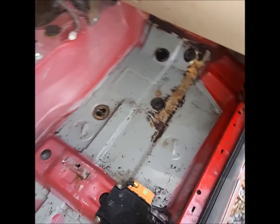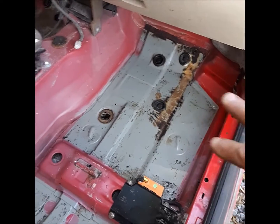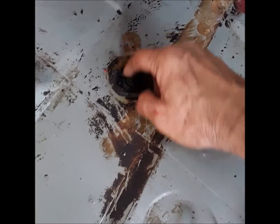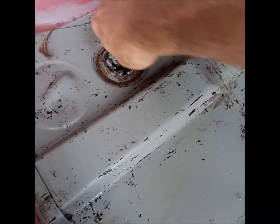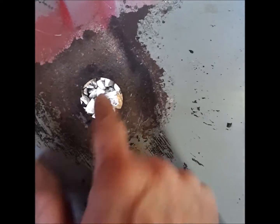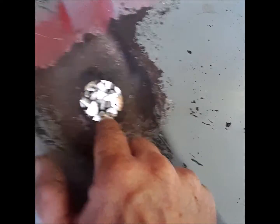Here's what I've got to work with on the floor. The passenger side looks great — I got all the sound deadening rubber off. There's not really much to sandblast over here. This rubber's messed up; I'll have to get a new one — I'll probably replace all of those. This hole is fine; I just pulled the plug out when I peeled the sound deadening off. This hole is solid but has a little surface rust, so it's going to get sandblasted. I think I'll go ahead and cut a plug and weld a plug into that. This side is rusted out a little more so I've got to cut this out, sandblast it, and weld that one up.